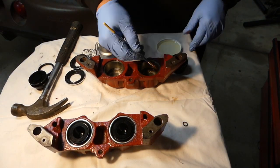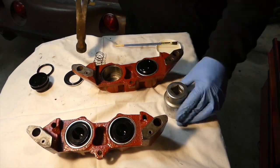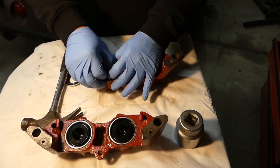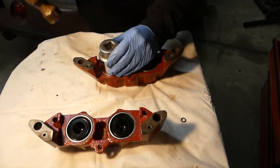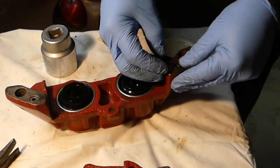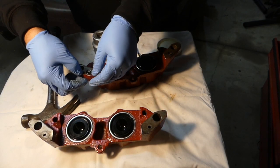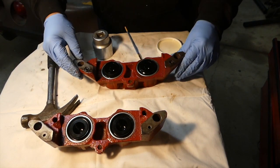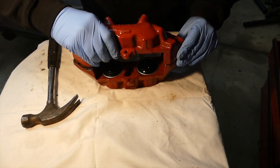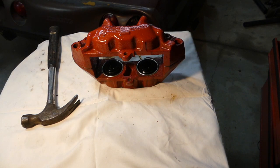I don't really need to show the second part because it's pretty much the same thing over and over, but let's do this in fast motion and get these last two pistons in — put the brake fluid on, put the o-ring on, put the seal on, tap it down. The small two o-rings go in between the halves right there where those passages are that we blew out earlier. We're going to have to torque these down — right now we just want to get them together and held, then we'll put them in the vise to actually torque them down properly.